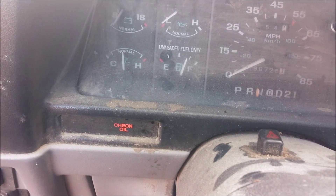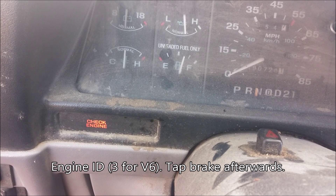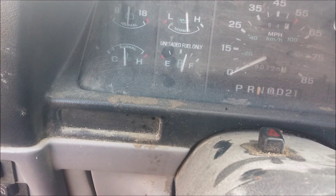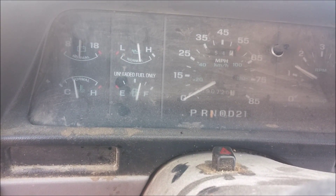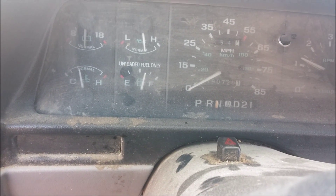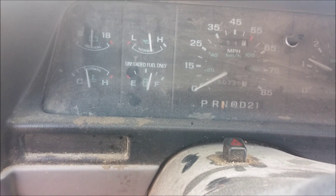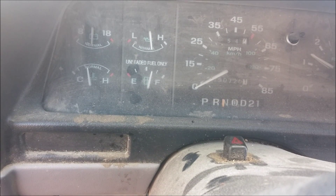This will be KOER. Do the brake test. I'm waiting for the flash to do the goose test. You see the RPMs going up and down by itself — that's the computer testing itself and the various engine controls.